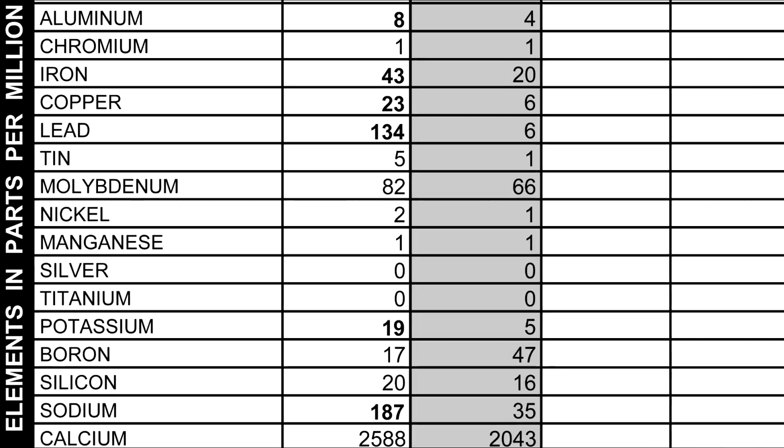And you just saw what a 300,000 mile Ford 3.8 liter engine looks like after it's been taken care of for all those 300,000 miles. Unfortunately, we do have wear indicated by the high iron, lead, copper, and aluminum numbers, but that's inevitable with an engine this old with this many miles.